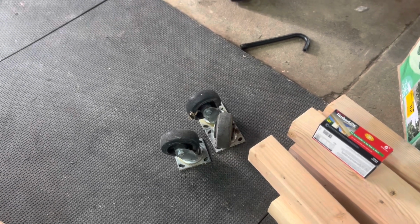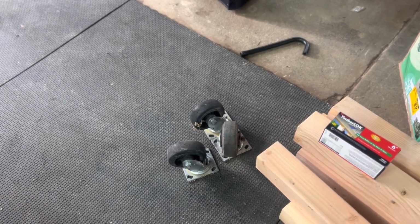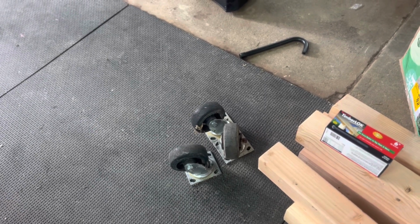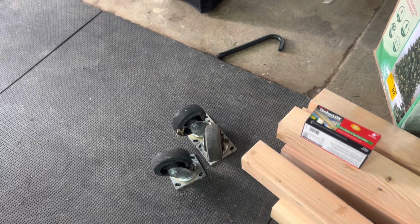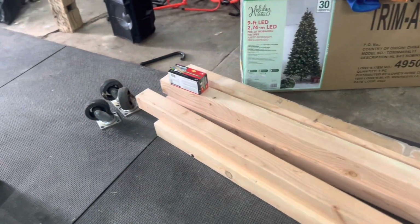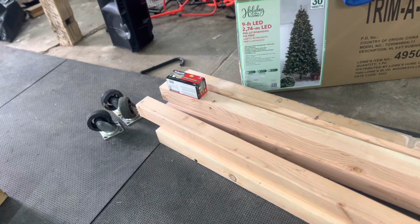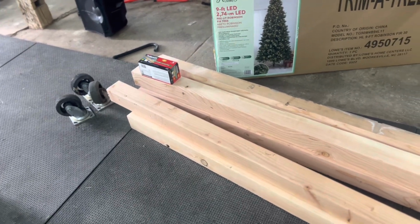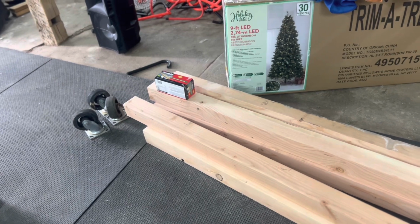But I had these from when I attempted to do a body cart 5 years ago at my other house. When I first got the Chevelle, I was going to do a body cart and take it off the frame. But I was looking at somebody else's and didn't realize the way they did theirs was they had a lift, a 2-post, and they were able to just lift the body off of the frame, and then they slid the cart up under. I don't have any of that, so the goal is going to be to lift it up and lay it on the cart, but it has to be high enough and wide enough that I can slide the frame up under. So that's the way I'm gonna build it. If I get a chance, I'll put the link in the description of the individual that I got this idea from.